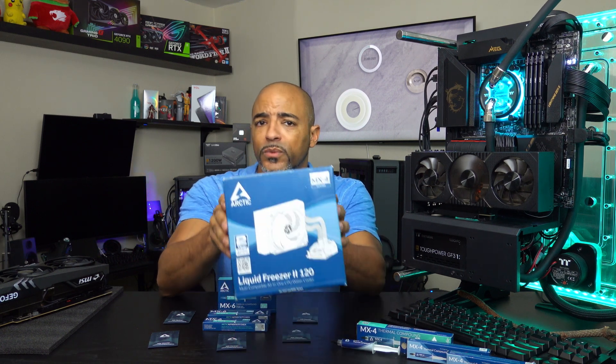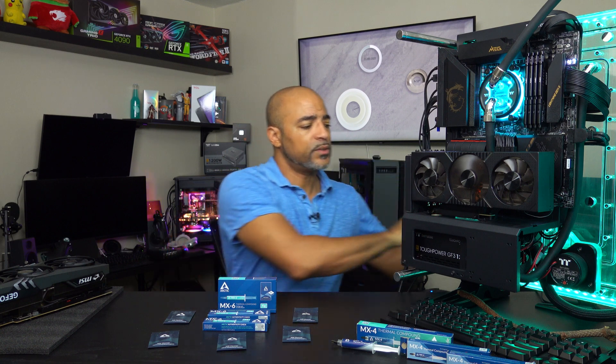The HP Omen 30L was a nice PC but the one flaw was that it only had a weak 120 millimeter AIO. I put this thing in — see the video on my YouTube channel — and yeah, it dropped temps drastically, reduced a lot of the noise, and eliminated all the thermal throttling. So not all products of the same size are made the same. Because of that I started to use a lot more Arctic products.